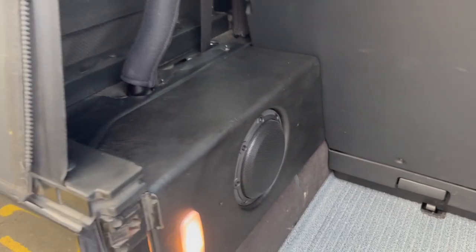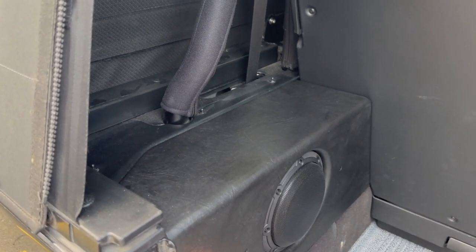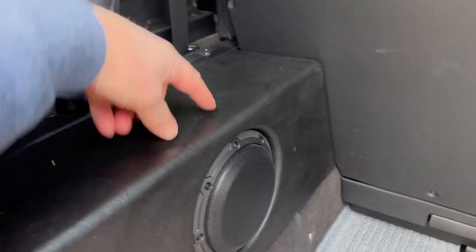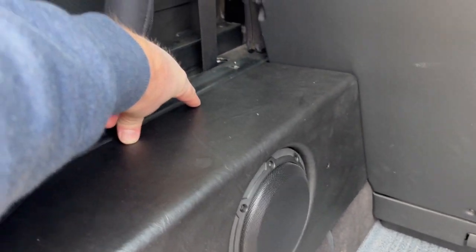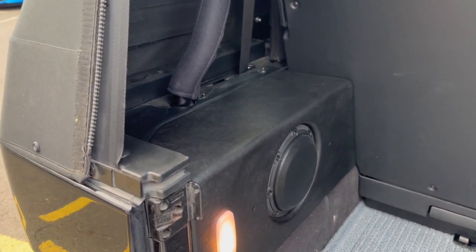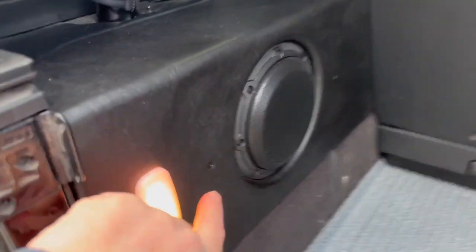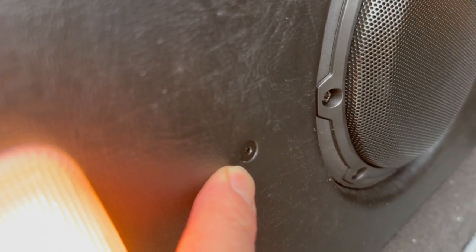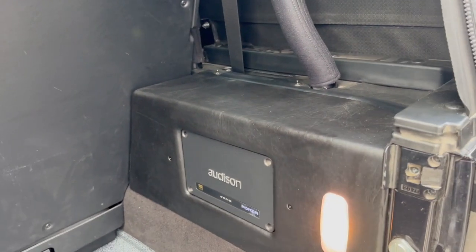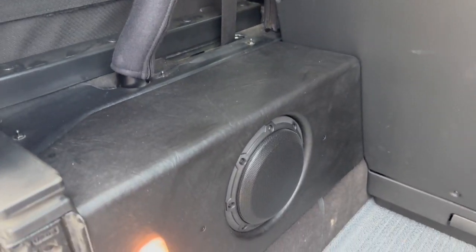Now this is all super strong. The reason is there are structural sections that run through here. Paul has fabricated steel plates and welded nuts onto the back, then drilled through. So we've got actual nuts and bolts that go through the back of this subwoofer, through the steel plate, and into the threaded sections - all wound up from inside. There's absolutely no way everything can ever move in here - it's incredibly solid. These beauty panels are designed to fit over the front, with little allen key machine screws. We've installed rivnuts on the other side in the subwoofer front and also in the amp rack, so it's completely serviceable - you can undo and redo the screws as many times as you want without chewing out the thread. It's really done properly.